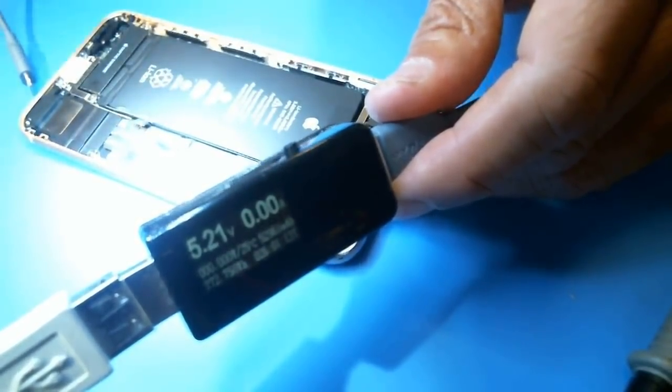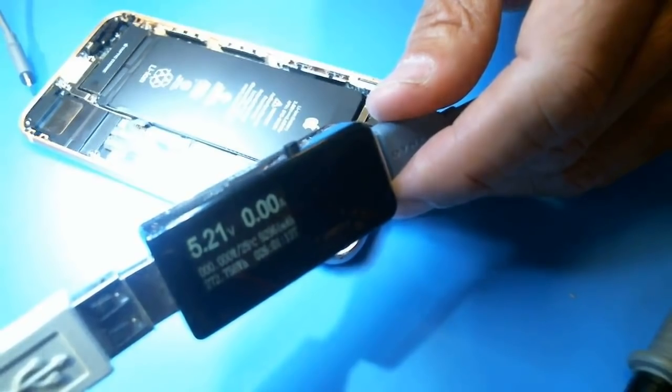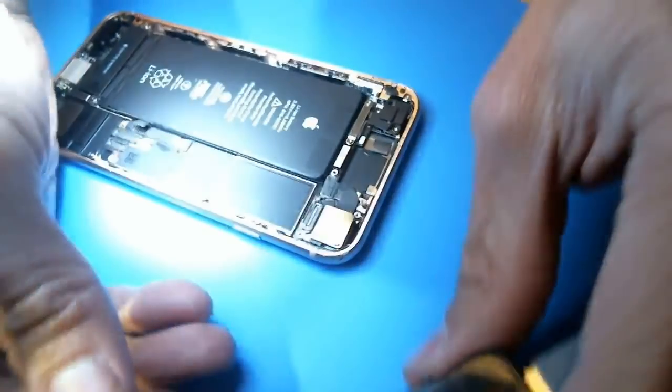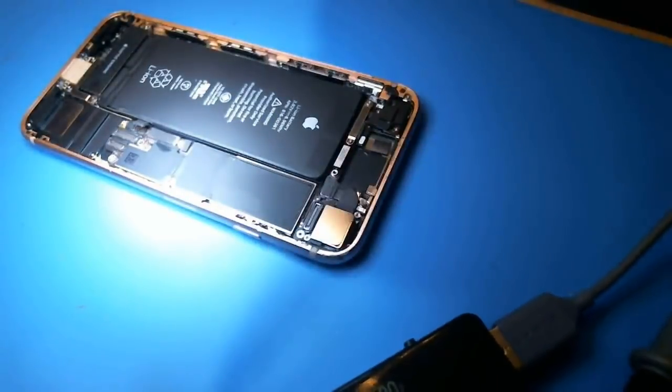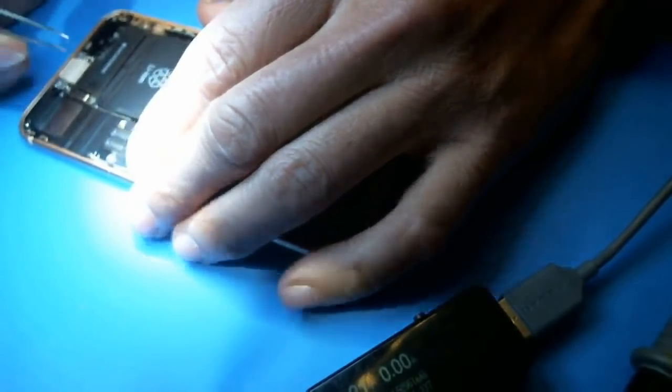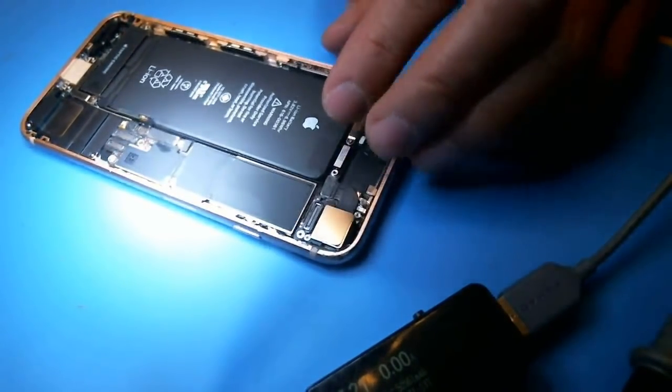So I can quickly say the phone is fine. Then what I do is shine a flashlight on the screen to see if I can see a backlight or not. If I don't see a backlight, then it's a display system problem, and then we go from there. Pretty simple. So now it's a display problem — okay, what's wrong with the display? I troubleshoot the display system.